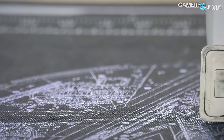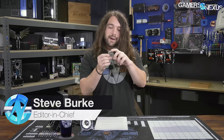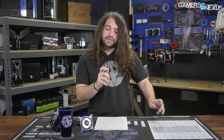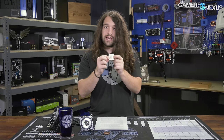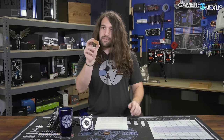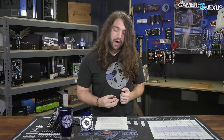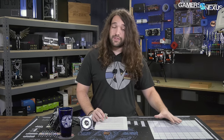We have three test subjects today. The standard nickel-plated heat spreader — technically we've lapped this one, but we're not testing on that side. These are what you'd find on an AMD or Intel CPU. This one specifically comes off an AMD APU, which is why you see the bump in the middle, but it's still nickel-plated copper. You can prove that by looking at the other side, where we sanded off the nickel plating to reveal just the copper. Nickel-plated copper is what you'd typically interact with with liquid metal, because it sits between the CPU die, the silicon, and the heat spreader — not between the heat spreader and the cooler.